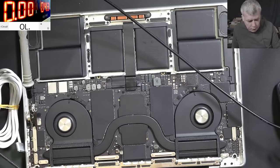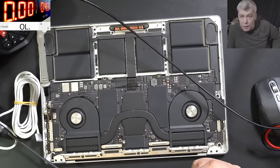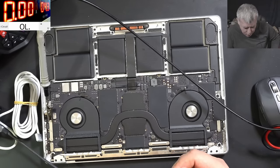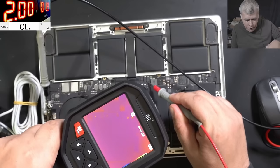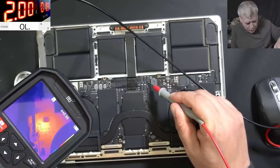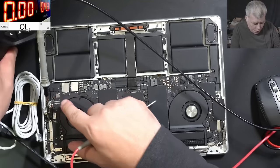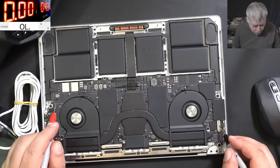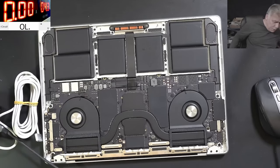Let's see if we can figure it out — can be an easy job. I'm not sure why Apple quoted the customer 600 pounds. I mean, don't they have a thermal camera? They can't check if it's a dead capacitor? What is that? It's a chip. This chip is taking 2 amps. You can't say that because the chip is faulty — maybe the output of that power supply is shorted. But the output is not shorted, so the chip can be dead. Let's check what the chip is and what it's doing.